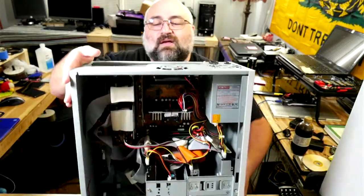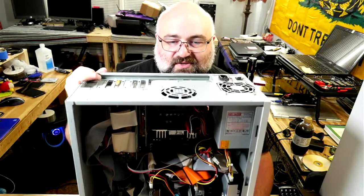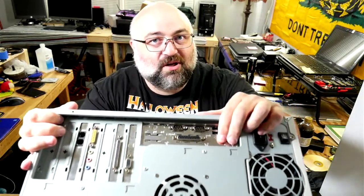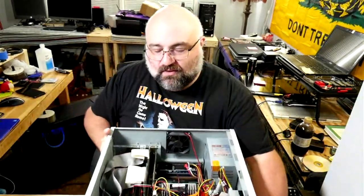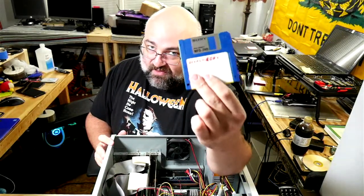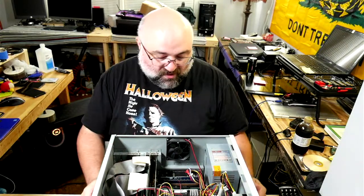But I found a USB mass storage driver, because Windows Me had that, but Windows 98 didn't. So the guy can use these two USB 1.1 ports, 12 megabits per second, which is roughly 1.2 megabytes per second. Which, to give you an idea how fast it was, that's not much smaller than this whole floppy disk. So, not really a problem. But he can go ahead and use a standard USB flash drive to get the data off this thing.